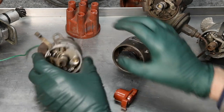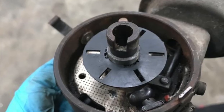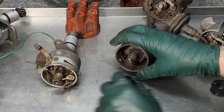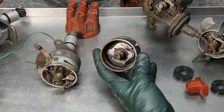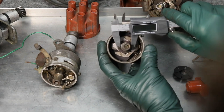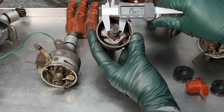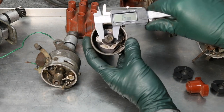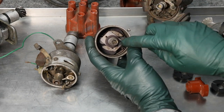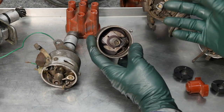You'll need to remove the points and the condenser, and get the shutter mounted onto the points camshaft. Now let's look at the measurement. If you have a distributor and want to check, I'm going to use a caliper here in millimeters — going right in to measure the width on the flat spots — and you can see that's about 15.87 millimeters. So if your distributor camshaft has that measurement, my kit is going to work and you don't have to ask anymore.